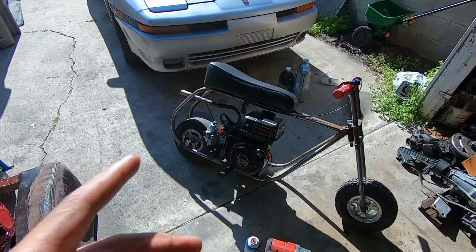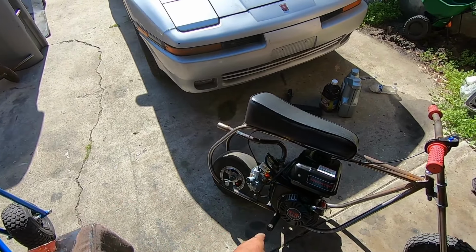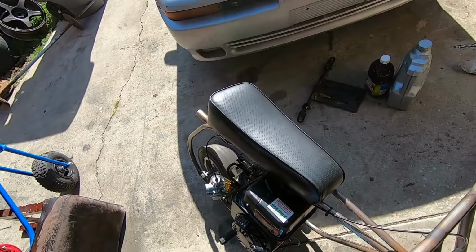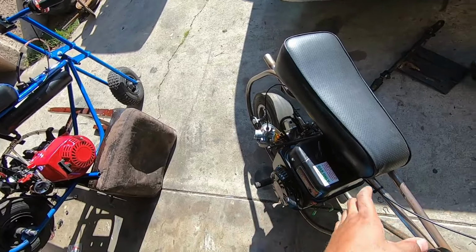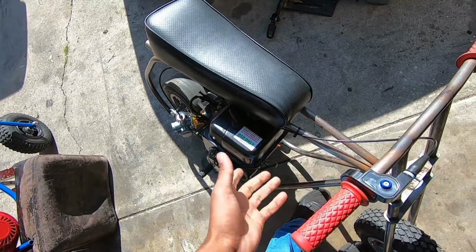Looking, so it's 9:50. So my boy Milton came through with his bike. So what I did to this one, we took the head off out of the header pipe and put in some 26-pound spring because he said the bike was slow. But the one thing, it was bogging. So it's either the carburetor is not jetted right or it's just the throttle. This is the race throttle. This is full throttle. Half a turn is full throttle.